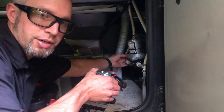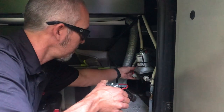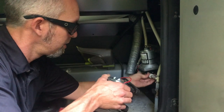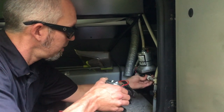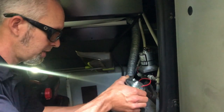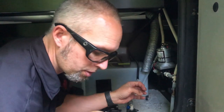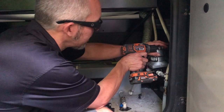That way I can open up the lines here and not have a ton of water come out. Now these fittings aren't going to be super tight — they shouldn't be. They're sealed with an O-ring inside the fitting on this particular model. This has happened to us before and I kept the old pump just in case I needed it for parts or to put it in here so we can still use the city water without the pump.